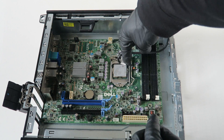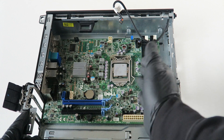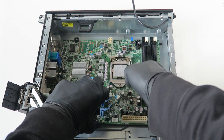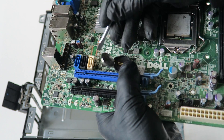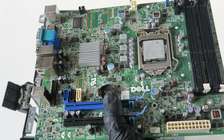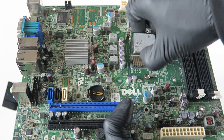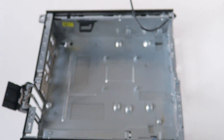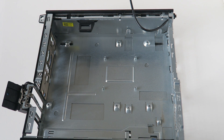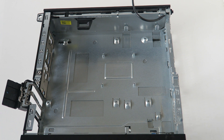Take your finger, lift the motherboard up gently, and it comes right out. Then remove the CMOS battery — use a flathead screwdriver, there's a little clip, and it pops right out. Finally, remove the processor. That's everything — the full disassembly of the Dell Optiplex 790 small form factor. Thanks for watching, bye.